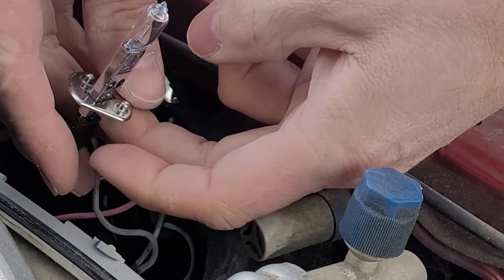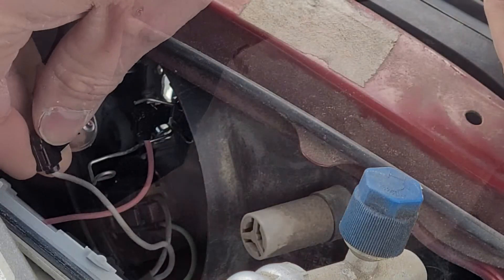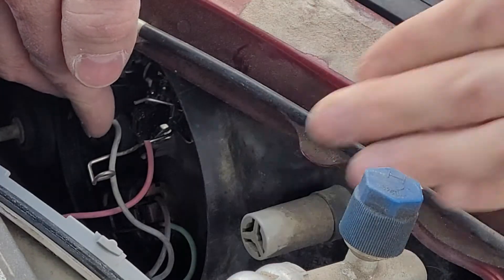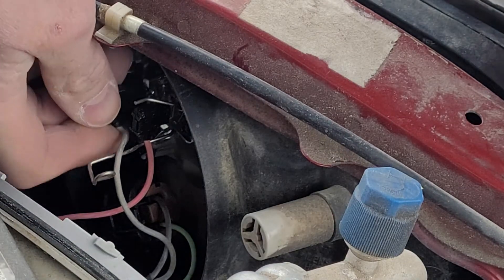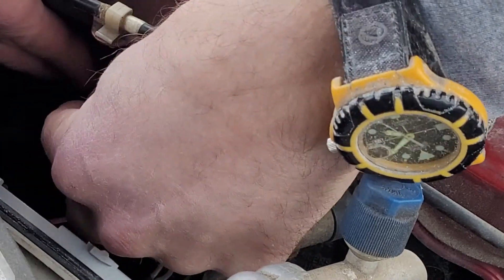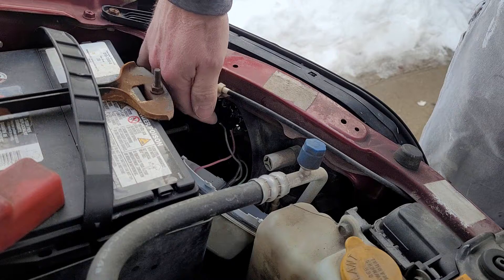Take your new light bulb and plug it in. Just make sure you've got the flat part oriented properly — the two little knobs on here are going to go into a couple of little holes. Gently insert it, making sure that the wire goes over top of the catch mechanism like this, then gently swing the mechanism closed and push it in to catch it.